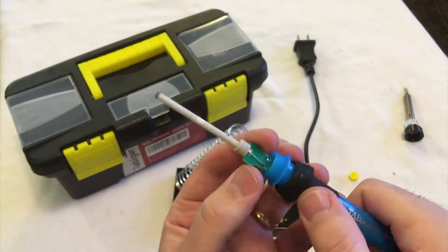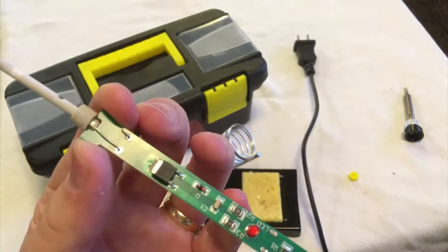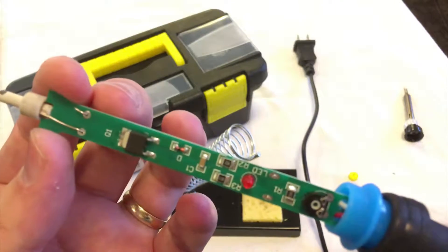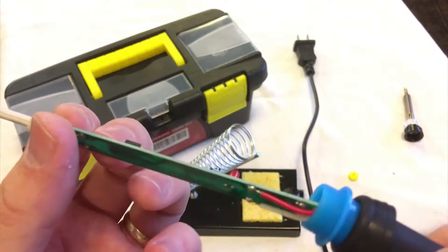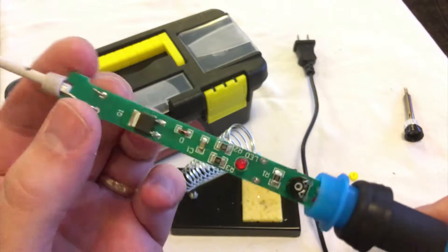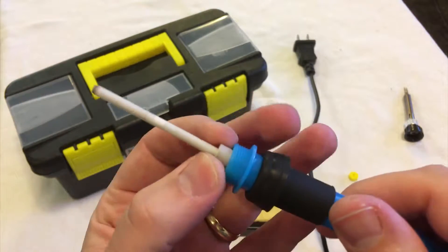When we look inside, you've got this heating element — I'm not sure if that's a transistor or voltage regulator — but there's a diode, capacitor, resistors, an LED, a variable resistor for the temperature control, and then your AC mains. There's no fuse on this, so keep that in mind as a safety concern.